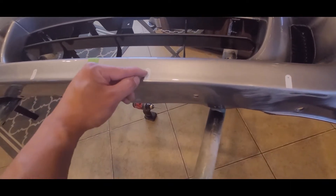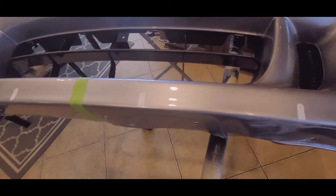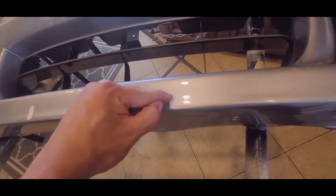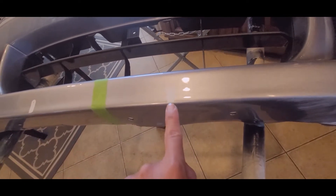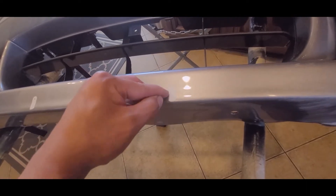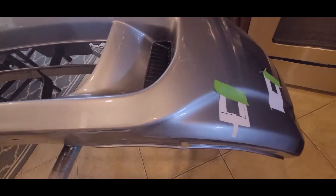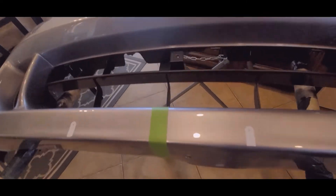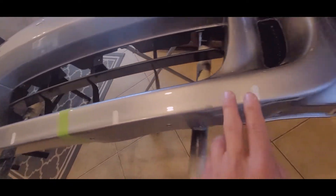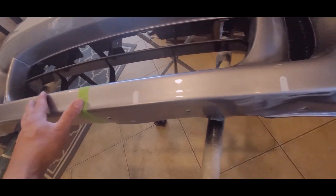The height of all these — if you look at pictures of the CR bumper — it's actually not right in the center between the sections; it's a little bit below. When I measured it, it's about 20 millimeters to the center point. I did verify by putting on the lip and taking it back off that these holes do line up. I like to start in the middle because it's a lot easier to have a reference point there — the outer ones are the harder ones.